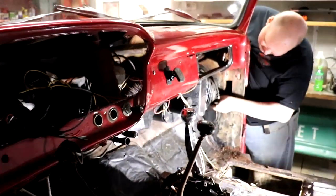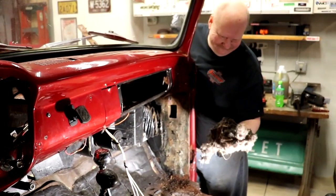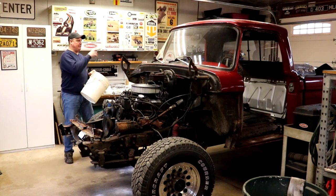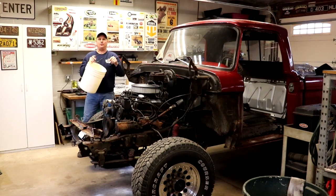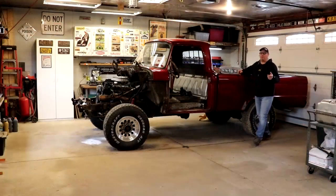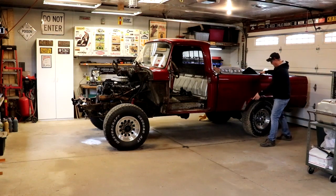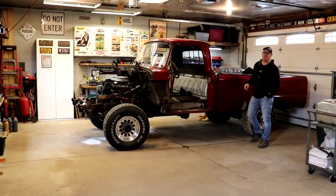How's it going over there? Let's get the heater duct off. The bulk of the mess is cleaned up — I'm gonna get the tank out next. We're going to put the uprights in and take this cab off and set it on the ground over there. The whole floor is getting cut out — we're redesigning the floor so that the cab actually drops down a little bit on the frame. The goal for this morning is to get this tank drained, this cab off, this bed sectioned into pieces, because I would say 95% of it is not going to be used. So we've got our work cut out for us today, but we're on it.